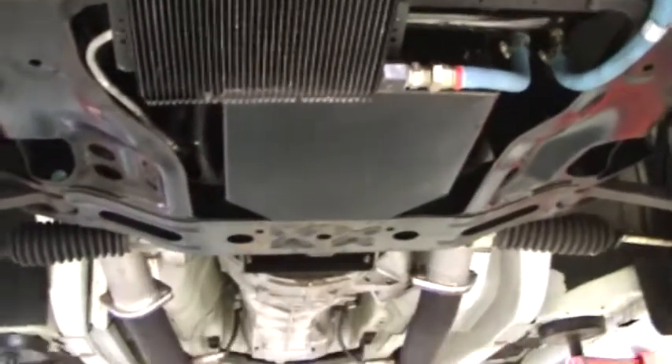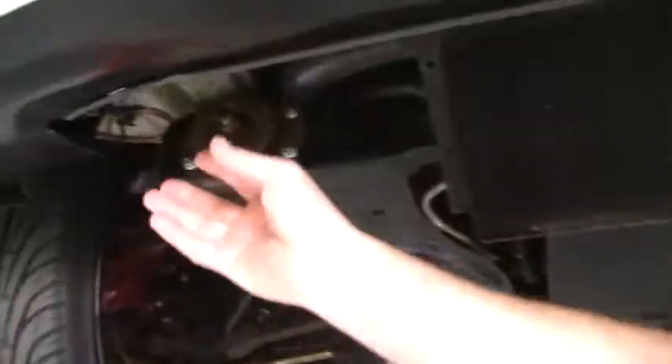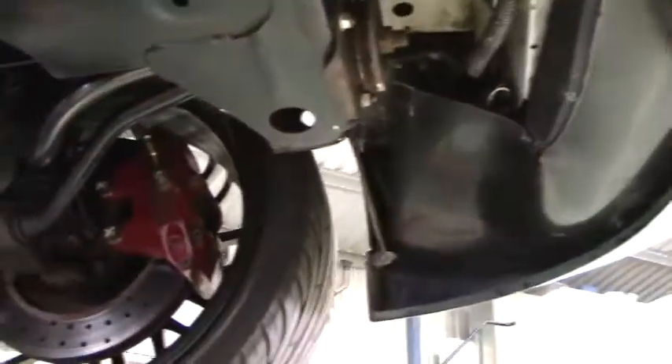Other features you cannot see: the clutch has been modified, the bucket clutch has been removed, and an aluminium flywheel with a normal heavy-duty ceramic metallic clutch plate has been put in there. Otherwise there is the high-energy sump and an oil cooler — we actually have a separate oil cooler tucked up inside here. You cannot see it from underneath here, but that is a separate oil cooler for the supercharger. And over on this side we have a large air cleaner system all tucked away up inside there.